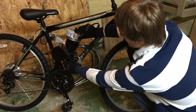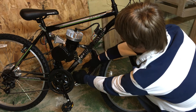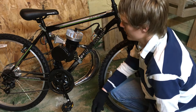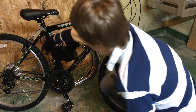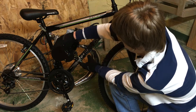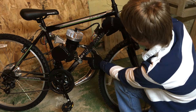You can either rotate the engine. In this case you'd want to rotate it downwards, so then the exhaust would be more curled in here towards the frame. That's probably the best option, however it will change the distance from the chain going to the back of the wheel, so the sprocket will actually be higher and you'd have to make the chain longer. It will also change the distance from your magneto to your CDI.